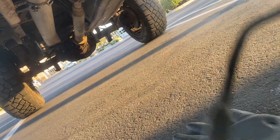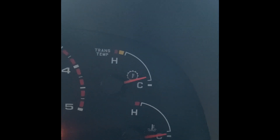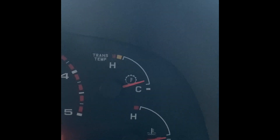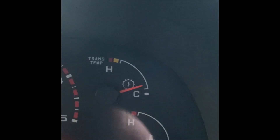All right, we got both sides back on. Go ahead and spray it down, wipe it down, make sure there are no leaks. Depending on how much rust you've got on your truck, some of these may be difficult to remove, so you might have to soak it in some PB Blaster. This truck is never going to see cold climate — it's a Texas and California truck. As you can see it's warming up slower because the fluid isn't bypassing the cooler through those cooler lines. It's better this way unless you live in super cold climates, but even then those valves will fail.